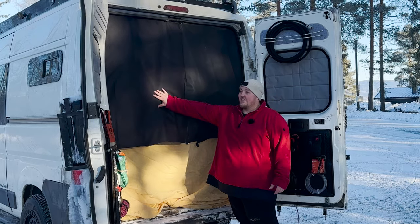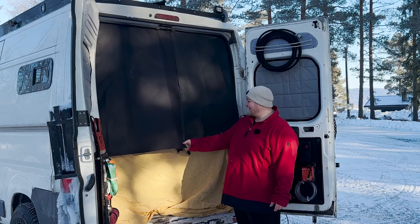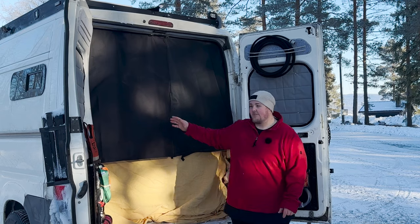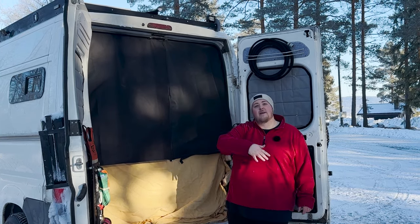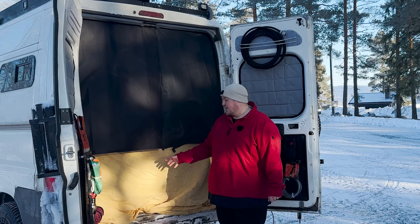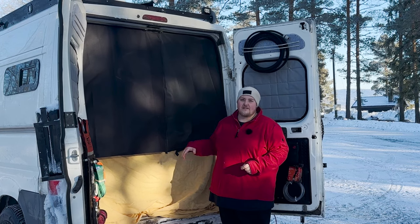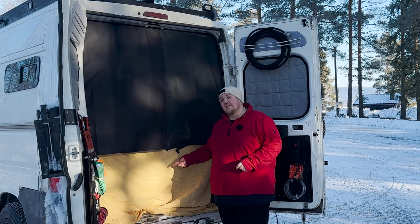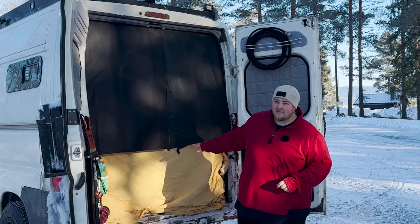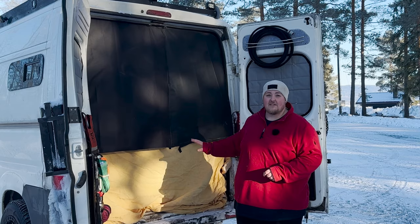While we're at the back of the van, you've probably noticed these covers. These are triple-layered double-bubble foil — obviously they're open so you can get through, but you lose a massive amount of heat through where the doors seal in the middle. This means we can have the back doors open and the heat doesn't just come flying out. There's also a thick wall blanket: the door seals on vans are terrible, so this stops the water tanks, pumps and batteries getting too cold. Our garage has generally sat around 12 to 15 degrees on this trip when the cabin is at 20 degrees.